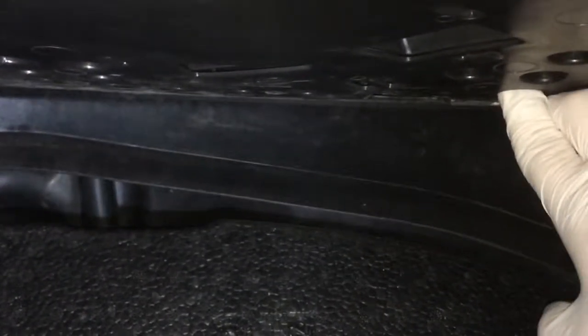And then we have, based on the air filter schematic, 3 screws: one top left side, one upper center side, one top right side. Then you need to carefully push this towards the front of the car and pull also down. Be careful, because in the middle, around here somewhere, you have a hook which catches the tray. Then you have the footwell lighting, which you have to turn counterclockwise, the bulb, and you can get it out starting from over here.